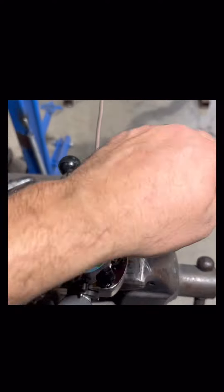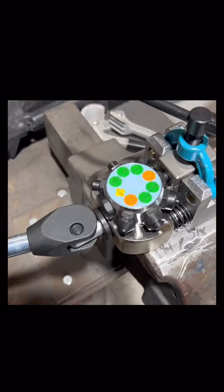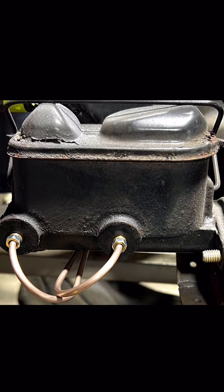At this point I'm taking the brake line and using our fancy new flare tool from Summit Racing — highly recommend it, you get a great flare pretty much every time, definitely worth its weight in gold. Up next is bending the brake tubing to match what I want it to do on the frame, making sure we're not hitting the cowl on the way out of the master cylinder.